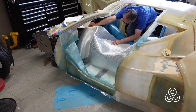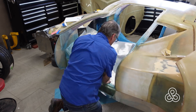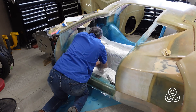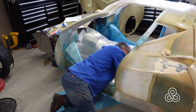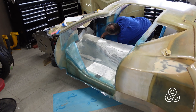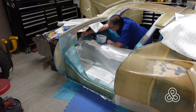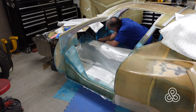The last thing in this video is adding one more set of fabrics to finish the tunnel interior — another layer of biaxial cloth and a layer of plain weave to get a nice clean surface. When you embark on an engineering project you should have design objectives spelled out ahead of time. With this car there was never a design point of making a luxurious interior to compete with multi-million dollar hypercars. A lot of people have commented the tunnel is too wide, but if I had imagined this car in a showroom I'd have almost certainly opted for a rear-mounted transaxle and eliminated the tunnel completely. But I've never planned to produce this car in its present configuration — my butt and my wife's butt are going to fit just fine.